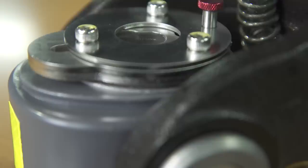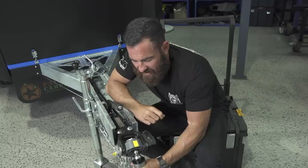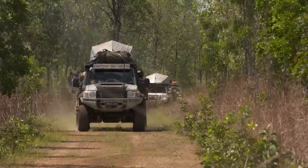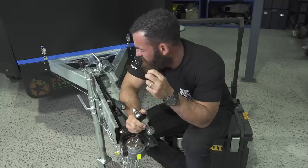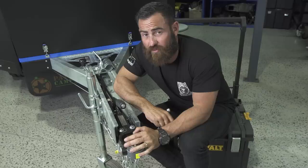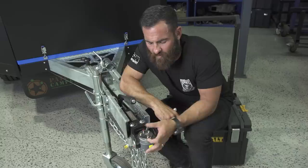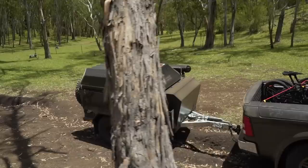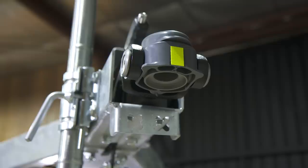If you're on a funny angle and you do need to get the trailer back on, you can manipulate this by hand. Another feature I use when connecting up my trailer — I'll sit this block in the upper position and as you roll back into it and it catches that pin, it'll roll over and drop straight back in. I think Cruisemaster have reinvented the wheel with the DO35, and every year there are little minor changes that as a manufacturer I notice — they're constantly improving it. They are fully rebuildable as well, with bushes inside and stainless steel plates with urethane plates in between, giving you a really nice slide. We haven't had any trouble with them getting gunked up, but maintenance is key — there's a grease nipple in the back, pump grease in every 12 months or so. When we put the trailer away we give it a spray with silicone spray or WD-40 and this thing will last a lifetime.